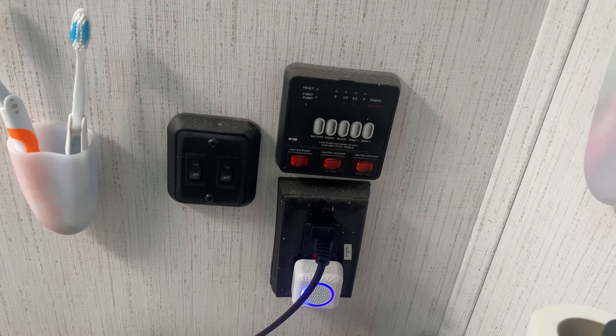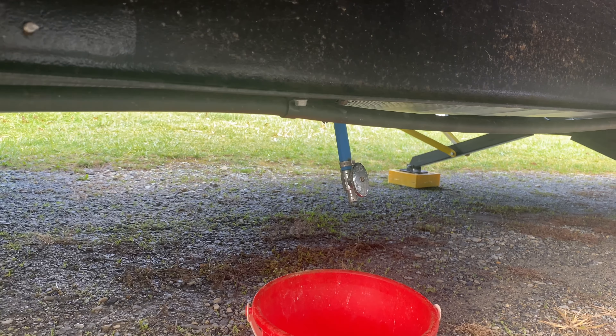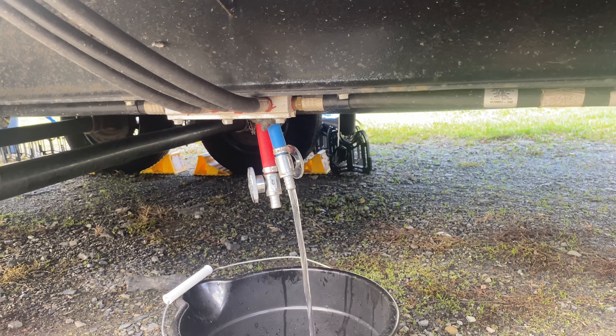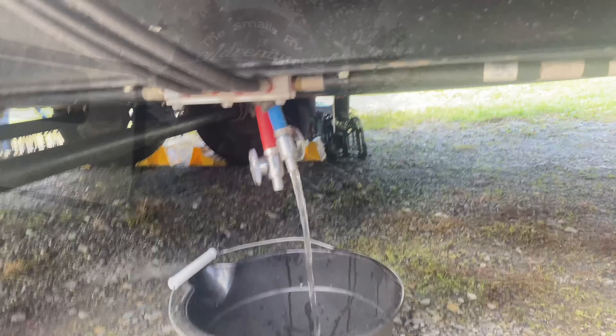Remember to turn off your water heater first, because you're emptying out the water from your hot water tank. Make sure to check for secondary lines because we have another line over here. You're going to have to wait for the water to stop flowing — it seemed like it stopped and then we have a steady flow again. With this process you're going to repeat two times, because after you blow the lines out some more water goes down there. The water coming out is clean, from your fresh water tank and any leftover water on the bottom level of your trailer and the lines.